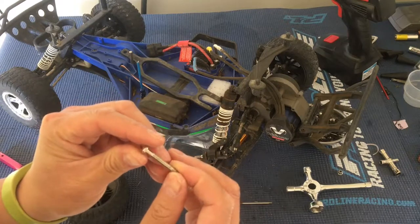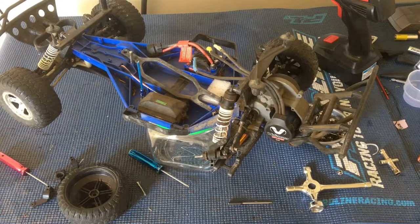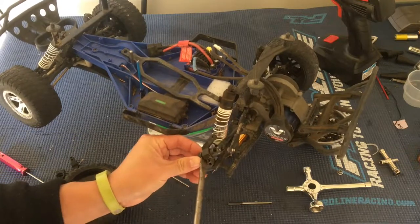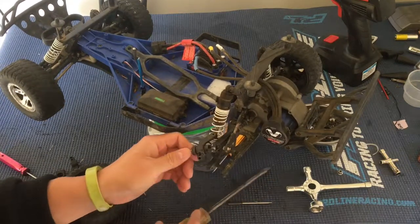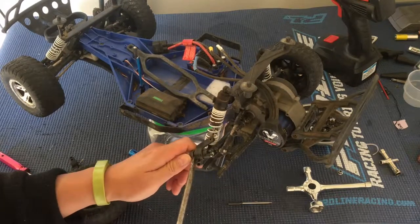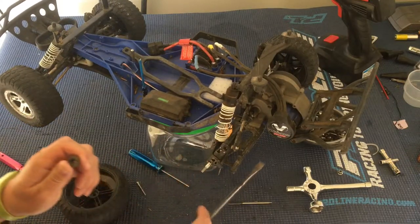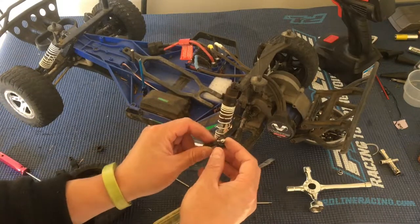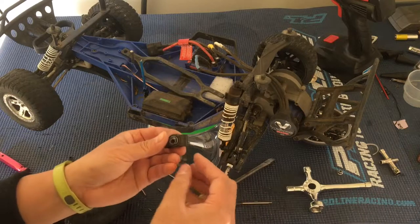Examine the pin — still looks straight, so we're good there. I'm going to grab a flathead screwdriver so I can pop the hex off. Make sure that you don't drop the washer. You can pop out the pin here holding that axle in, then pop out the axle. Don't drop this small washer.